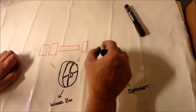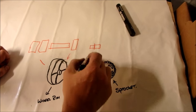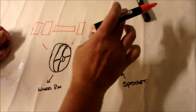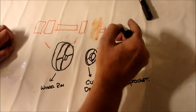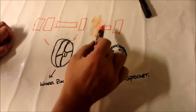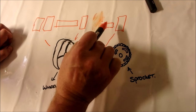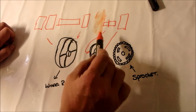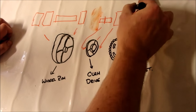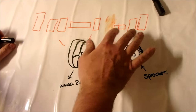On the cush drive you have what is called a coupler and then you have a bearing. The bearing goes in one side, the coupler you push in from the other side, and then the bearing goes on that side. It is very important that you do not forget to put the coupler in, otherwise your bearings will be ruined. You have three bearings for the wheel, a coupler and a bearing for the cush drive, and then a grease seal on the outside of each side.